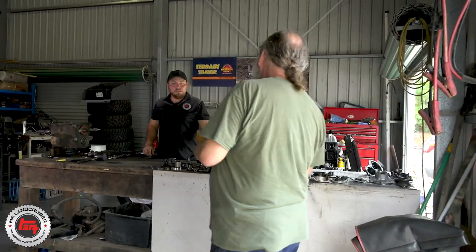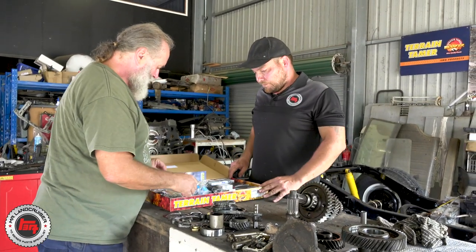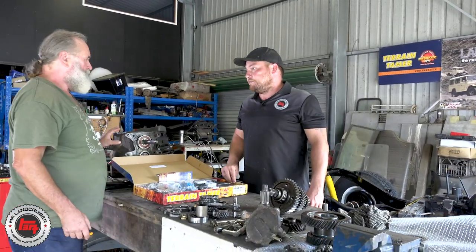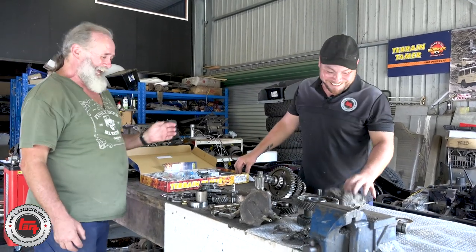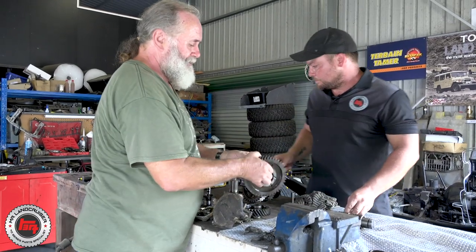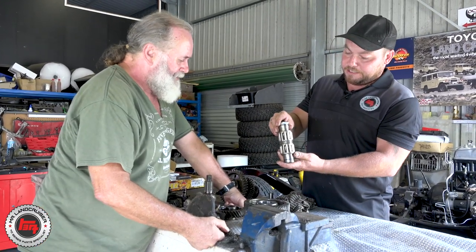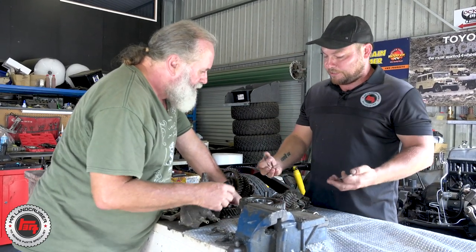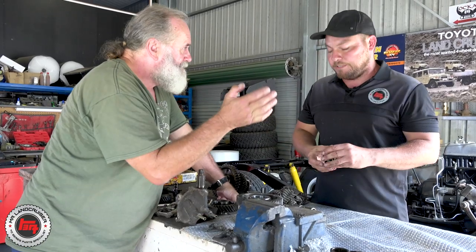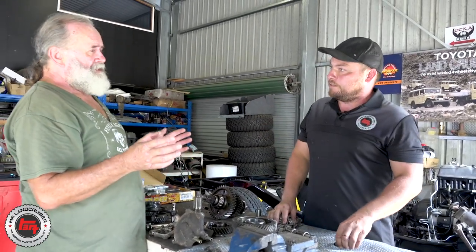John arrives with the Light Bridge kit - this is the most comprehensive kit ever, definitely. So what did you find, what's the noise? Well the gearbox itself is in fantastic condition - unbelievably so. The problem was in the transfer case on the idler shaft. We've got the thrust washers here - for the benefit of those who don't know, this is the transfer case's high and low range shaft, the shaft that runs through the middle. The needle bearings and cages that support it are held in place by two thrust washers, and look at the wear on them - they've almost worn through, creating too much side movement as the helical gears load on and off power, moving it backwards and forwards, getting worse and worse.